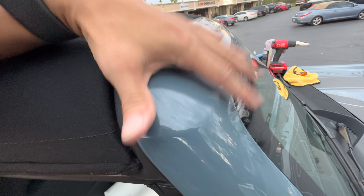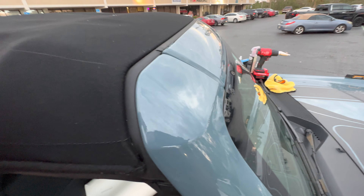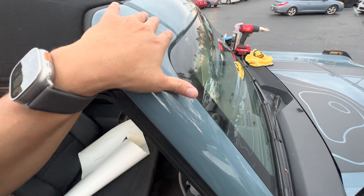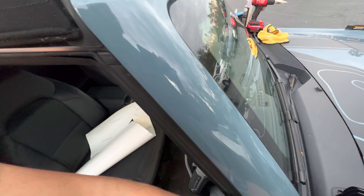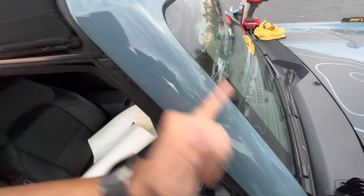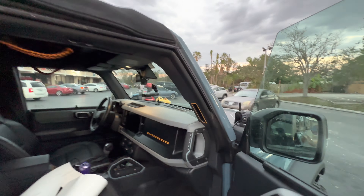That's why this side looks so much better. On the first attempt, I tried to line it up and then just stretched it downwards, and I had to stretch it so much. So keep this material fully drenched in Sticker Fab application fluid, put it on, get a decent alignment down the pillar, then start squeegeeing out the fluid, and then work on this curved part. That application fluid helps you move it around as much as you like until you start using the squeegee to get out the fluid, and then it helps evacuate all the air from under there.